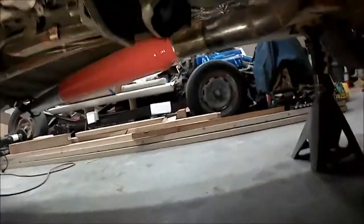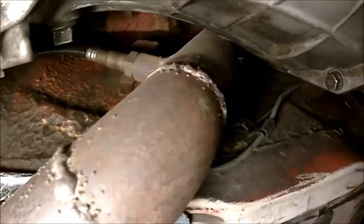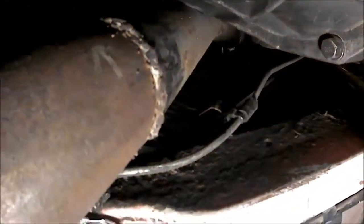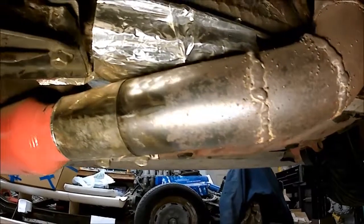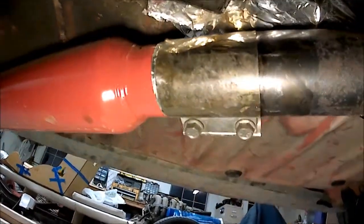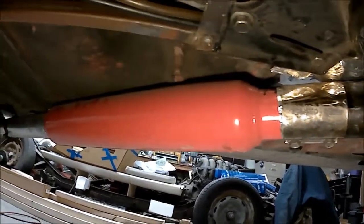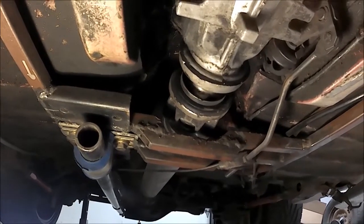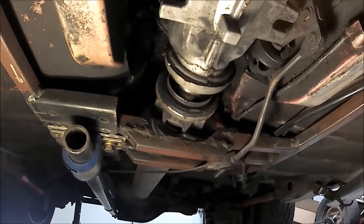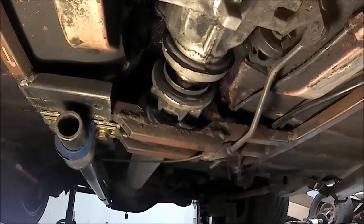Here's another view of the exhaust setup — two and a half inch exhaust. We run into the same problem others describe: very little room to fit the exhaust pipe between the transmission and the footwell, let alone fitting a clamp or flange. My solution is just a straight pipe all in one piece, and then a band-style clamp which runs about $10 — it wraps around the outside of two same-size pipes and clamps down tight. Also, the crossmember I made for holding the torque arm doubles as a drive shaft safety catch, and this has already done its job — I snapped the drive shaft on launch at the 2019 Grassroots Motorsports Challenge and it caught the drive shaft perfectly.